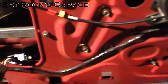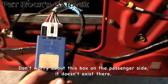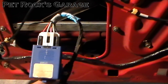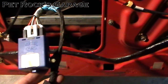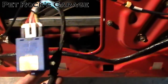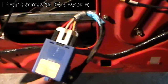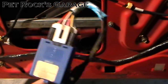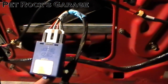When trying to test this, make sure you have this little box thing plugged in — it's hidden inside the door panel. This is the power window one-touch-down switch. When you press the down button the window goes all the way down from one touch, and it is also in between the switch and the window motor. Without this plugged in, the window motor is not going to work at all, no matter what you try. So make sure you have this plugged in when testing your window.